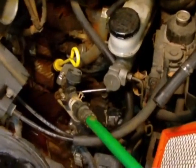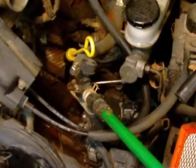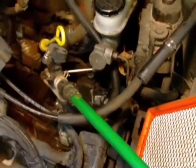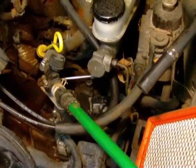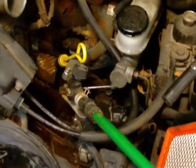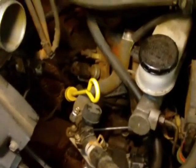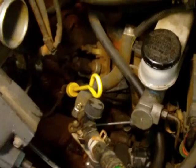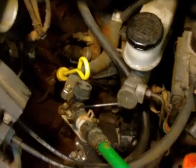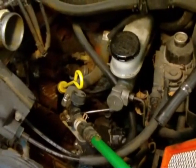This connection I'm showing right here — I removed it from the engine and slipped a smaller diameter hose into the end. It fits real snug; it's a good way of doing this. I've isolated the heater core. As you can see, there is a tap on that hose that I'm not going to use. I don't want to bother with the engine at this point — I'm just interested in flushing the heater core.